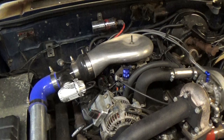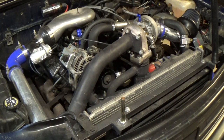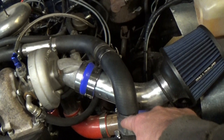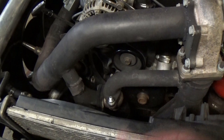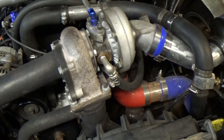Most of the intercooler piping I bought in a kit on eBay for about $120 — the intercooler, all the black piping, and the blue couplers came with it. I had to make my own adapter to go off the end of the turbocharger compressor outlet, which is a two-bolt flange. I fabricated one out of a 38mm wastegate flange, welded a pipe to it going from the one-and-three-quarter-inch turbo outlet to two inches, and then used a two-inch to two-and-a-half-inch coupler on that adapter. It has worked fine with no leaks.